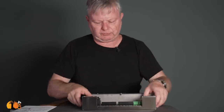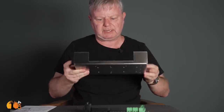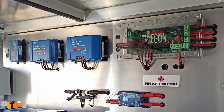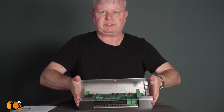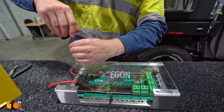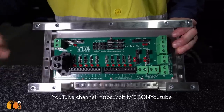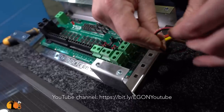Once you've run all the cables to the hub, you can see the mounting box has lots of holes behind it — you can mount it any way you like, lots of mounting options. This mounting box is sold separately. It also has a clear Perspex top, which fits on so that once installed it's very easy to do a diagnostic because you can see the LEDs. Five Allen key screws remove the top so you can change a fuse, correct issues, or add cables if you're expanding the build. We've created a YouTube channel with instructions for mounting, wiring, and different types of DC-to-DC chargers.